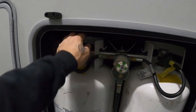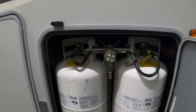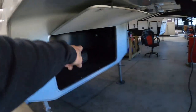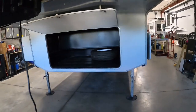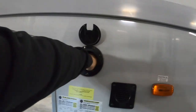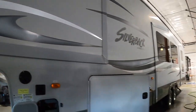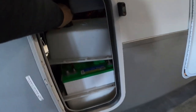Point the selector toward the tank you wish to use — open means open, and green means you've got gas. Up here is big storage with your spare tire. This is the manual override so you can hand-crank your slide if needed. Check your battery posts every day on the road — make sure nothing's wiggled loose while traveling.